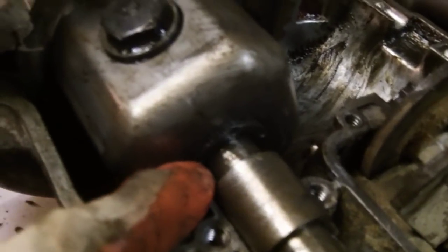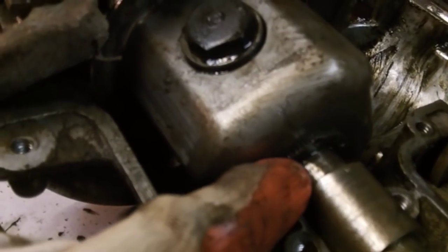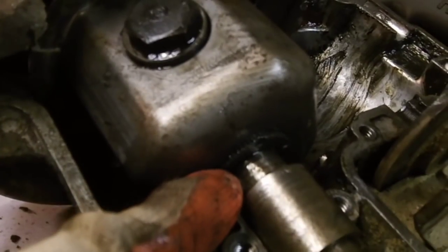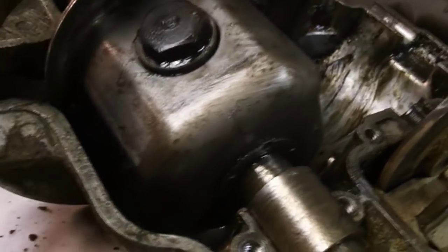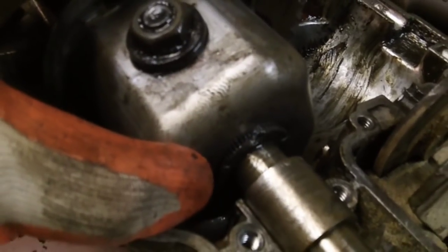What I'm going to try and show you right now is, if you pull the axle as far out as it possibly can, there's this lip going into the differential cover. What I'm going to do is weld that all the way around so that that entire area is welded solid to this cover — essentially making that part of the axle.